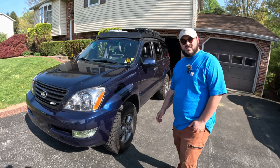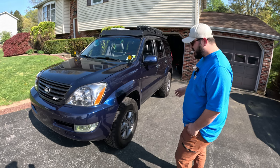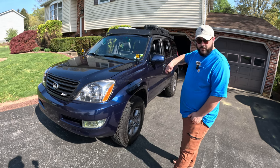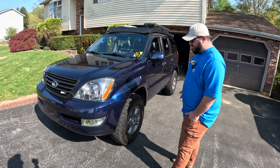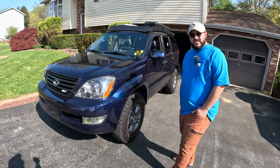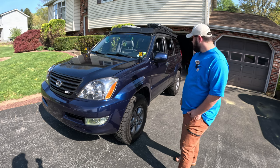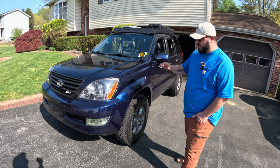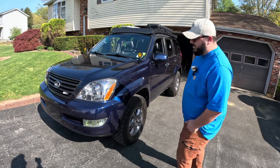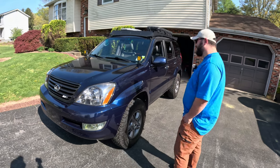And isn't there some issue on the frames with these — they rust out? Yeah, a lot of Toyotas are known for that. On this one specifically, the front cross member that goes underneath the radiator is something to look at, and then also the rear bumper support, which are really easy to check. If you work with a good seller they should be willing to provide photos of those areas. If they were rusty, that stuff can be welded. If your frame rails are rotted that's a different story, but anything cross-member related can be repaired. Either you pay somebody or if you have the know-how it's not the end of the world — but buy a clean one.